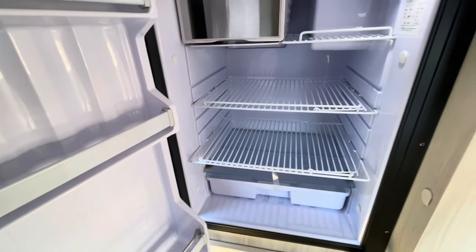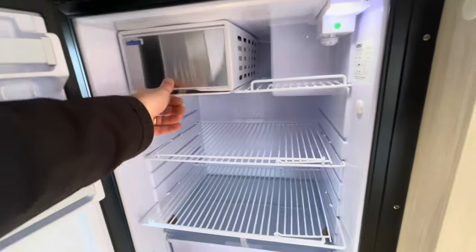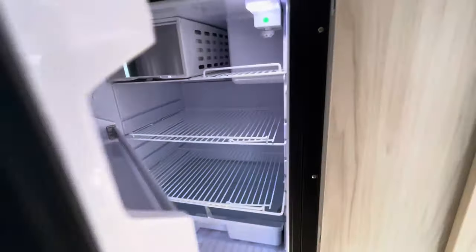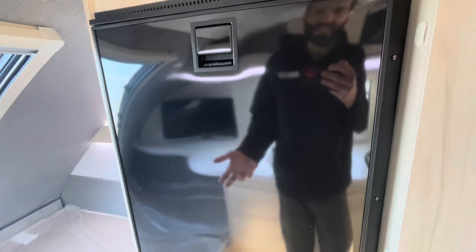This is going to be a larger 12 volt fridge. With that much solar on there, you're going to be hard pressed to run it out. You've got a nice little freezer up top. We've tested these fridges — with a 175 amp hour flooded battery, it lasted two days; add 100 watts of solar and it lasted 14 days under optimal conditions. This trailer has 310 watts of solar standard and one 100 amp hour lithium battery that can draw way lower than a flooded battery, so you're not going to have too much of an issue with this fridge.